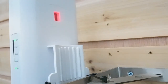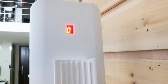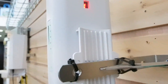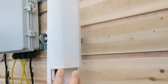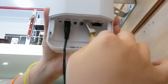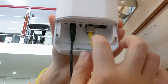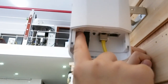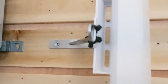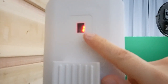Let's turn to the back. This shows the channel number — you can see it's at zero. I'm going to press the button and change it to channel one. Remember this number because we have to match it with the other bridge. Now let's come over to this wireless bridge. The power source is already plugged in. I'm going to use an ethernet cable to connect with one of the ports here, and use it to connect with the PoE switch later. Since this is the slave bridge, make sure you turn it to the slave side. Now I'm going to set the channel to number one. Alright, so now we have matched the numbers.